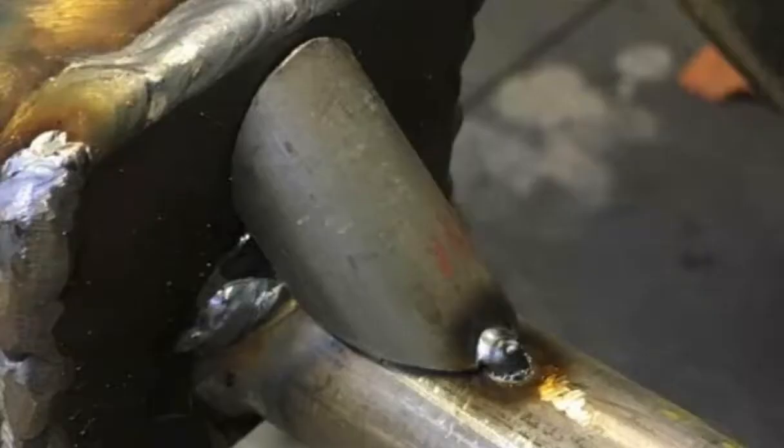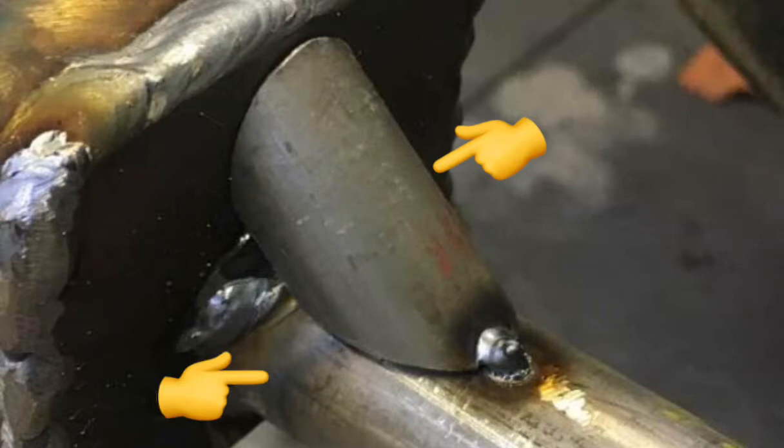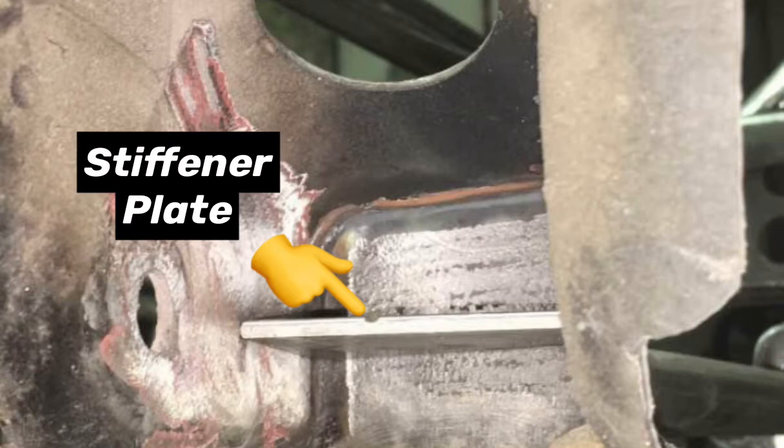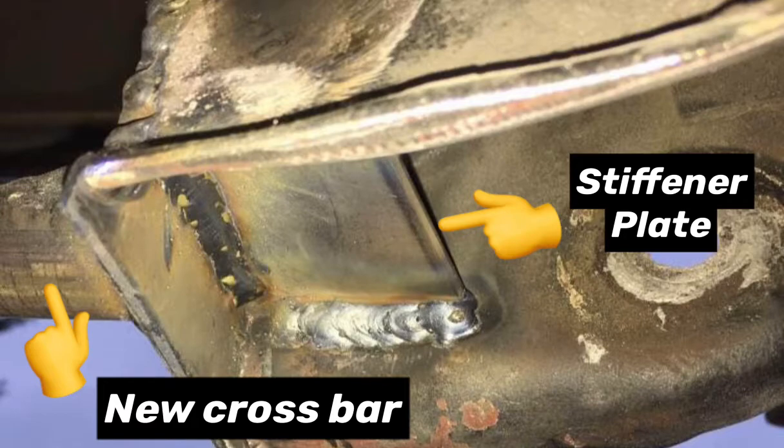Here's a pic of the actual front frame section that was cut away. I've jumped ahead to show where I've tack welded a little brace, and beneath it you can see the chromoly tube that ties it back together from one side to the other — with the cap plate already welded in. I opted to mount the chromoly connector bar to the center of this horn because I like the looks of that better. But doing so, rather than staying close to an edge, I had to weld in a plate underneath to create structure so it wasn't just welded directly to a flat facing plate.